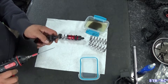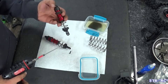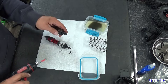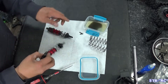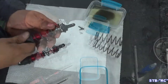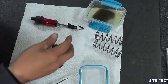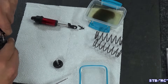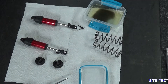Let's get that done. Let's take a two millimeter and we're going to remove these little pinch bolts. There we go. Now we can go ahead and loosen this preload up just to make it a little bit easier on us. Now we can just pull the spring down and remove the retainer. We'll get rid of the spring for now — those springs are going to go on the front shocks.